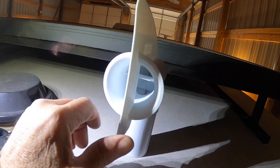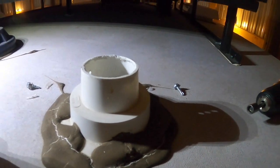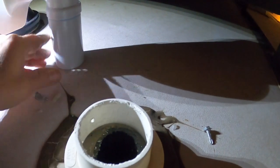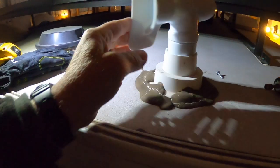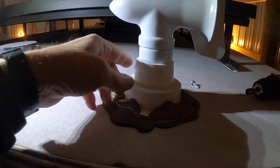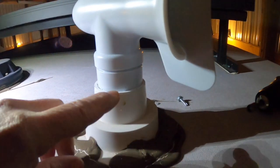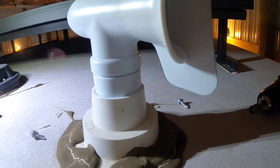It works well. You get the flange - I think it comes with it. All it does is slide over the black pipe. You probably want to chop a little bit of that off, and it's just going to go over that pipe and into the flange. There it is - you have yourself a weathervane on the back of your trailer that people are going to ask about. Put a self-tapping screw into the side to hold it on so the wind doesn't rip it off, then put a little bit of silicone caulking around that seam to keep water from running down into the flange.